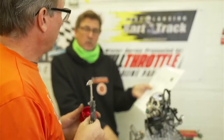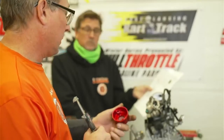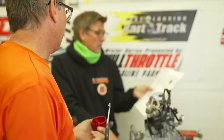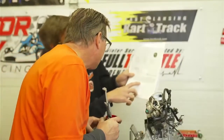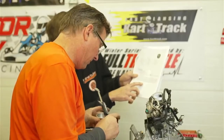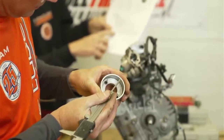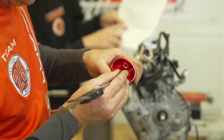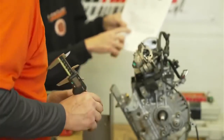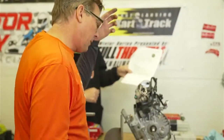There are a lot of conflicting numbers in the book. They're giving a lot of room for the maximum, but making something thirty thousandths bigger isn't really going to help you anywhere. We're looking for something out of spec and we have not found anything out of spec on these two cups. The last thing is this number in red — they changed from ten thousandths to thirty thousandths, referring to the radius on the edge of the part. This one has almost no radius; this one probably has a thirty thousandths radius. That's hard to measure and probably won't help or hurt you.